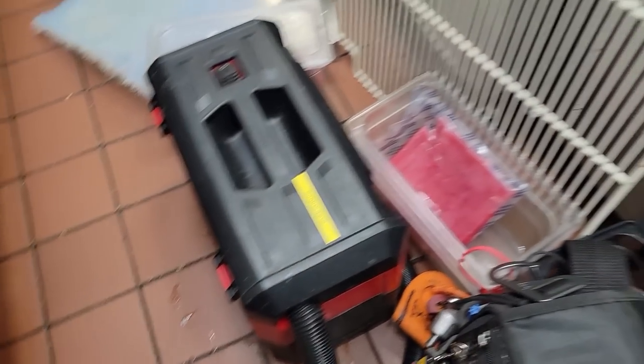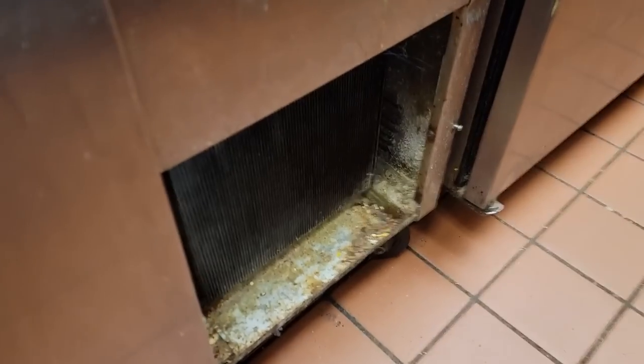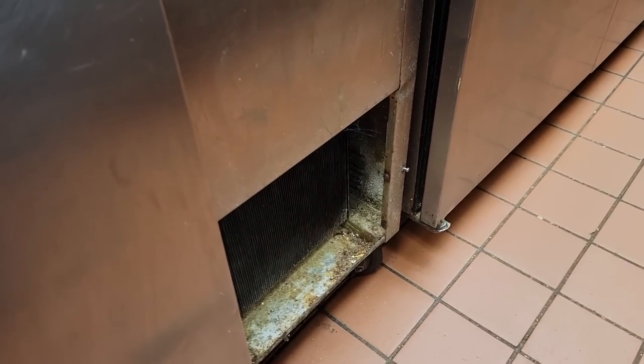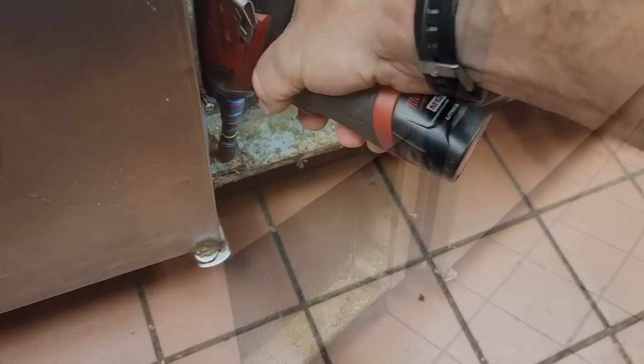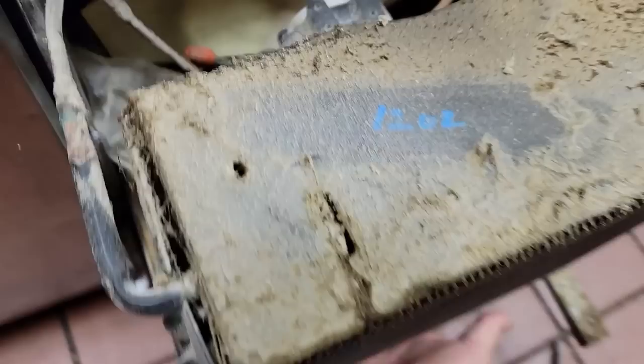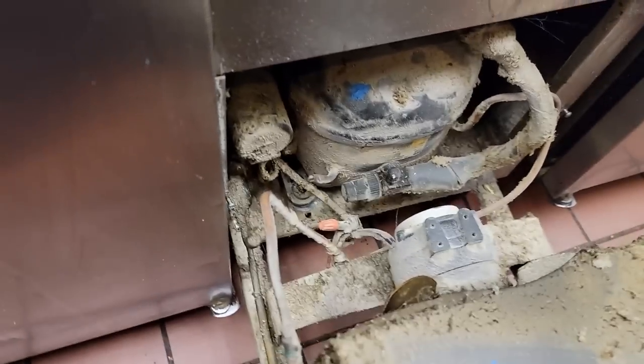The first thing I had to do was sweep all the water out, because we had quite a bit of water in there. The condenser is really clean — I keep an air filter in front of it, which usually gets packed full of dust from pizza, flour, wing mix, stuff like that. I don't remember if this has a refrigerant tap on it — I couldn't see one. So we're going to see if we can get in there and check if the suction pressure is up to a normal level. It says 12 ounces — that's my marker, so it's probably been low before. It's got valves built into it.